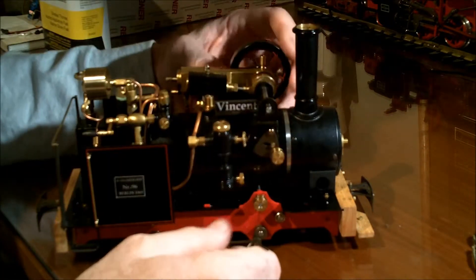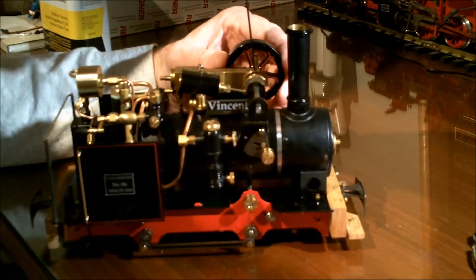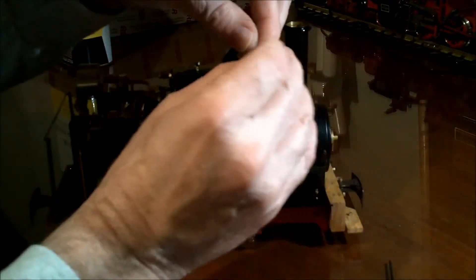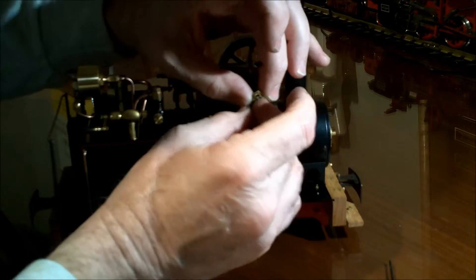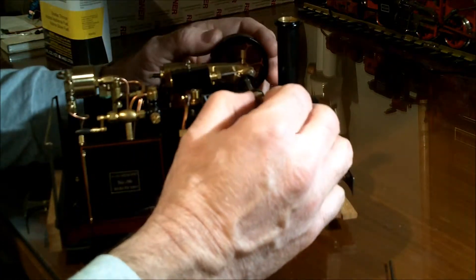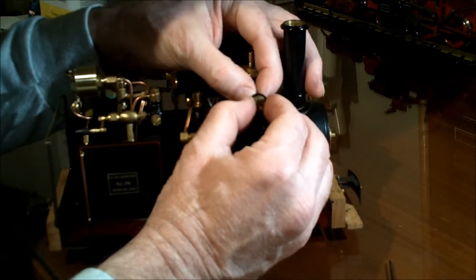Give the driven side just a little tightening so it stays in place, then give it a shot — everything looks good, tighten it down. Right now we have no end play, or maybe a thousandths of an inch end play on the driving side and the driven side. The play will be handled by the placement of the sprocket. Be careful of the little bushing washer. The most important thing is the end play — where the slop is.